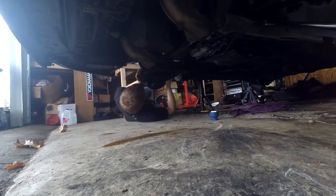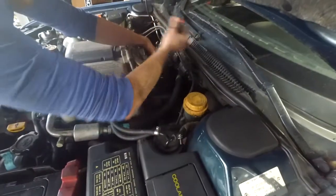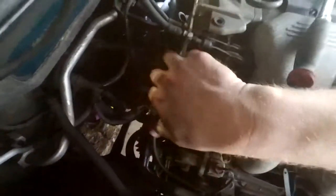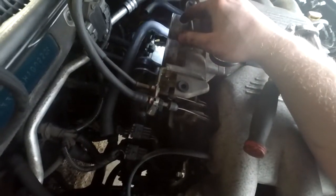Right now I'm going to work on the axles. Just getting the dog bone off, and after that we'll take the connectors off and everything, all the wiring connectors. We got the two wire connectors unplugged. All this stuff's going to stay in here. We got one of the bell housing bolts out, part of the starter. We still need to take out the bell housing bolts on that side — just probably take the whole starter off so it's easier.